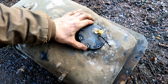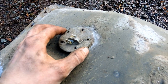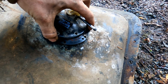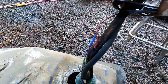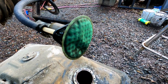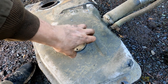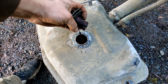Okay, so this kind of does look new to me — you can see the difference, there's a little grime but it's nice and black compared to the rest of the tank. The sending unit looks to be probably the original, or at least outdated. So my thought is they really did put a pump in here. It says 'Made in Japan' too, that's pretty cool. The gasket looks pretty new — good old aftermarket fuel pump. The strainer is pretty nasty — used to be copper, now it's just green.